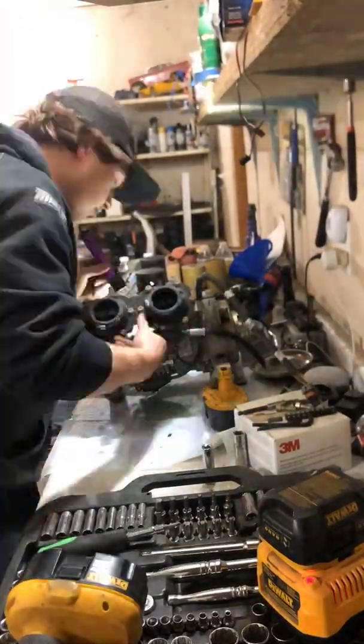This thing is still holding together because you can see where it circles around the case and splits on both sides. I've got to pop my stator off now, pull all of it out, and then we can split the case. Actually, if you guys look over here, it looks like it's supposed to ride right there — looks like that much of it came out of the case. That's a good finger width, because the starter won't hit the clutch gear anymore when it's spinning. I'm pretty sure the crank end actually popped out of the case at least a quarter inch, so let's get that off and see what the damage is. All right, I got the stator all unbolted and now she just comes right apart.